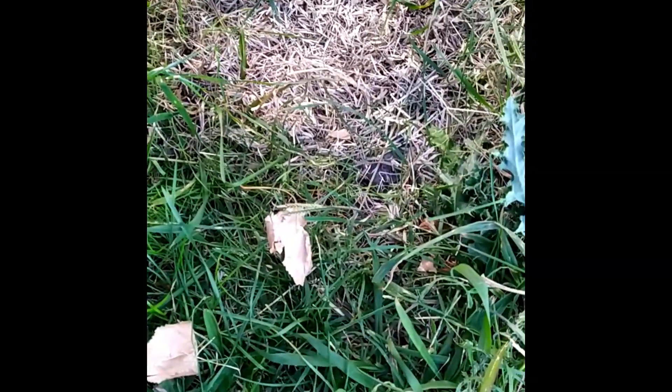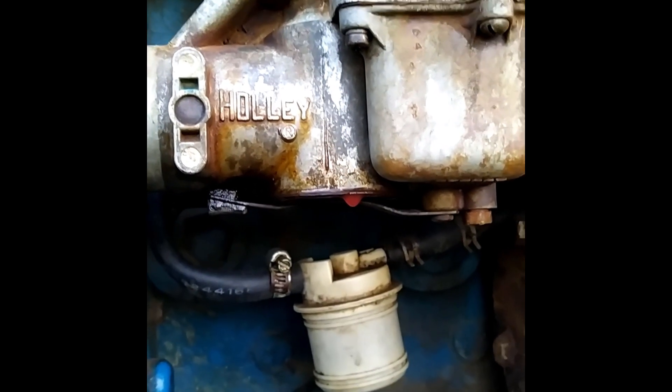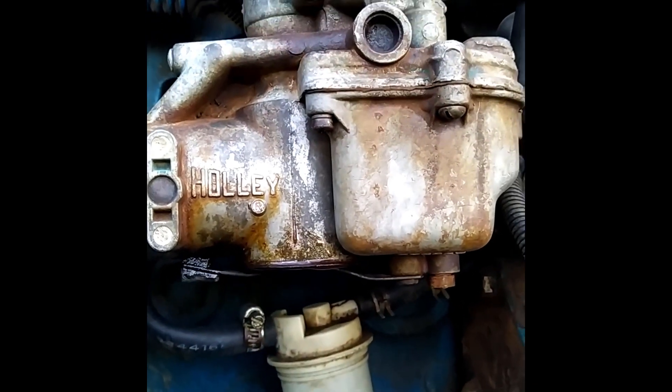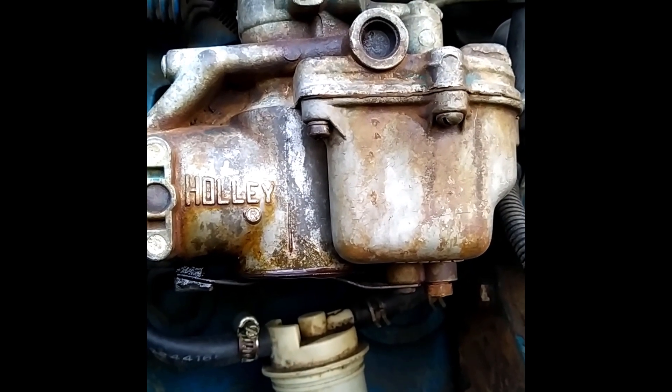It's wanting to start. I have got it going like this before more than once, but now it really doesn't. I think I've got a leak here — see, that's dripping off the air filter. I'm thinking we might have a carburetor problem. What do you guys reckon?